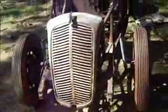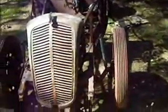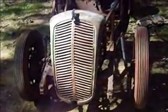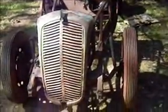Then we move around to the engine compartment. As you can see, the car is pretty minimal. It's a lot lower than the original Morris Z. For the front suspension here, I have retained the standard Morris Z axle, and instead of the lever arm shock absorbers, I'm using telescopic shock absorbers from a Morris Mini. Of course, this entails making up special brackets, and that was a bit tricky to get them looking right.